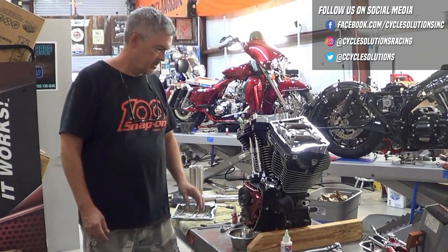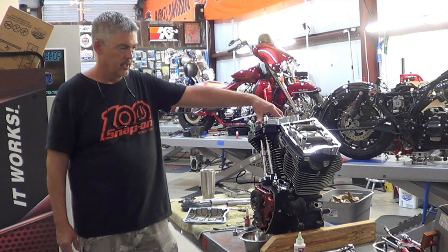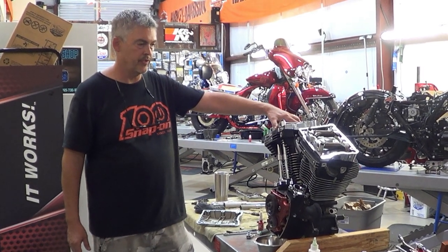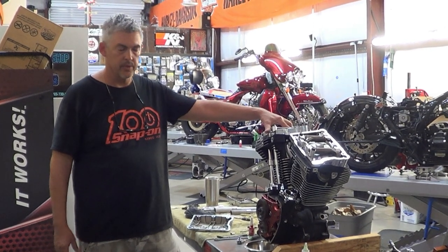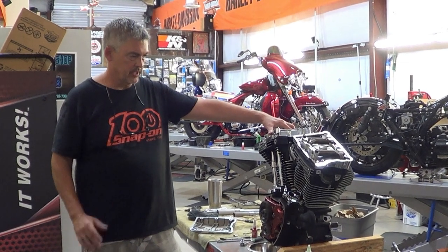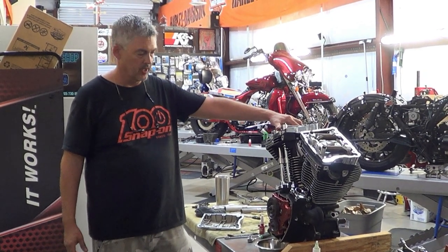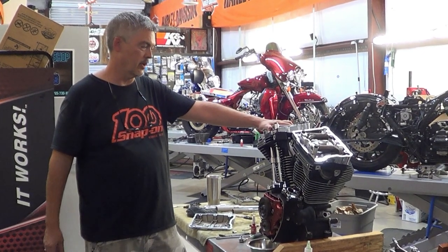I'm in the shop today. This was an absolutely destroyed 103 inch motor. It's kind of a hybrid — it's got the old-style cases, actually an 04 chassis. What we've done is we've redone the crank. It's got a balanced welded crank; Dark Horse did the work for us there. We did the Timken bearings in it. Because the crank is absolutely dead straight, we were able to go ahead and use a gear drive cam, which I prefer. Zippers cuts me a 657 lift cam specifically for the S&S gear sets. It makes a ton of torque and a ton of power.